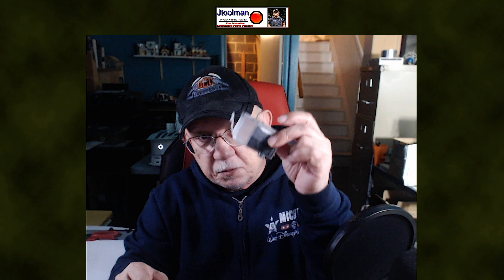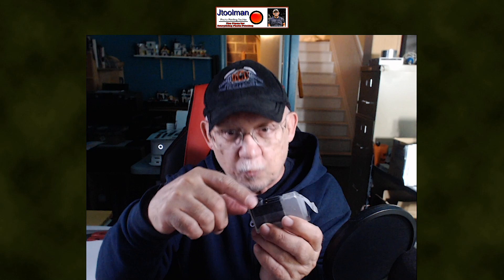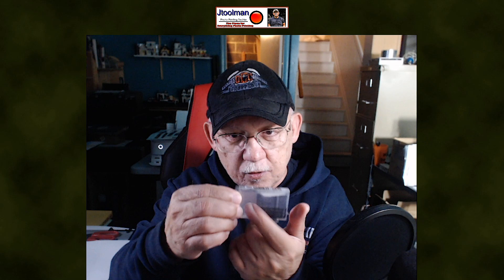Once you achieve the target weight, put one of those clips on and you're ready to refill. Since the sponge was flushed there's no need to prime that port. You would only do that the old way — seven years ago — if you knew nothing about flushing cartridges. People would add a little bit of ink to wet that port, put the clip on, and then just add ink to the liquid chamber.